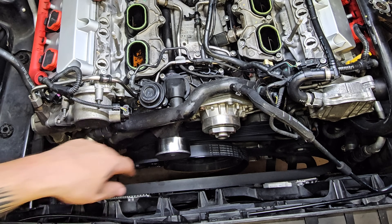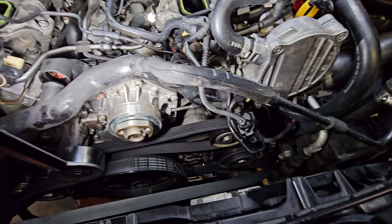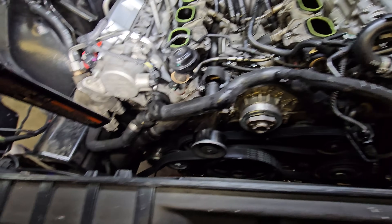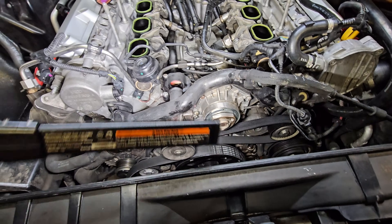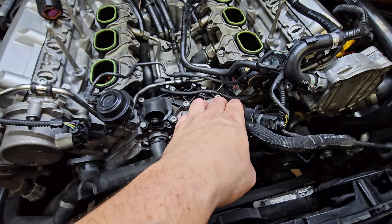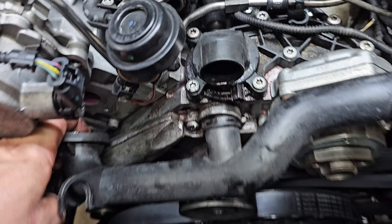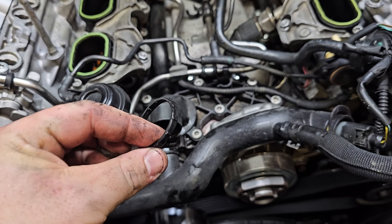As I removed all the screws the pipe actually came out on its own, which makes life easier. It did start pouring out a good amount of residual coolant. Do not disconnect it from each side of the actual radiator piping, because if you remove those gaskets you'll need to replace those too. Pull it back gently — you don't want this thing to snap. With it out, fish out all the O-rings: there's one on each end and one for the middle of the pipe, which usually gets stuck inside.